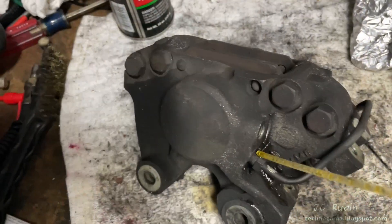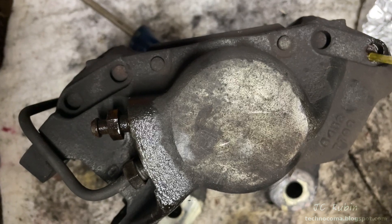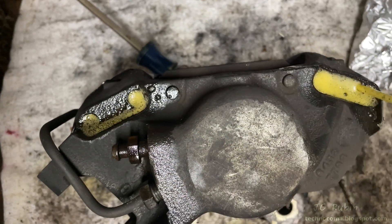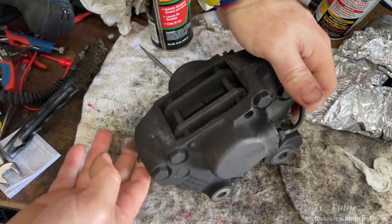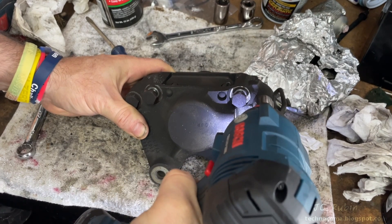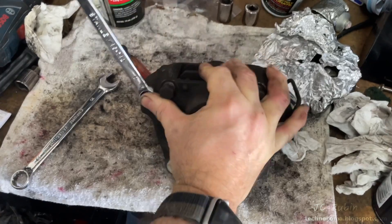It's evening now and I'm applying oil to all the areas where the e-brake assembly bolts are. The next morning we'll see if I can open this without putting it in the vice. The open end has a recess where I can pool up some oil overnight and let it drain inside. The next day all that oil is gone — maybe it absorbed into the threads. We're going to try with the impact — the first two in the middle were no problem at all. The two on the outside proved to be a problem. Switching to plan B — the first one required minor percussion and it loosened right up.